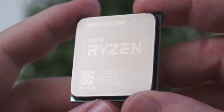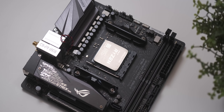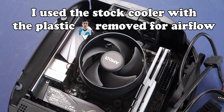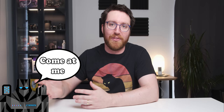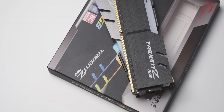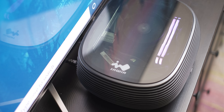As far as the APU goes, I used a Ryzen 3200G, which is a perfect match for this system considering it only has a 200-watt power supply. It's still powerful enough to stream all your videos and movies, and you can emulate PS2 games with it according to others on the internet. For RAM I'm using 16 gigs of DDR4 3600MHz, although I had issues with my G.Skill Trident Z set, so I switched to Corsair, which worked after down-clocking to 3200MHz.